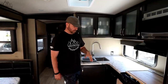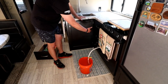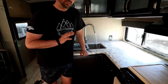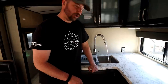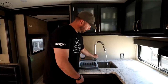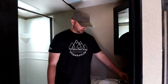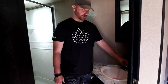Next up — everyone's favorite part of de-winterizing: getting the antifreeze out. That means camping season is here! I normally have antifreeze in this bucket when I winterize; now I've got fresh water in the bucket. I'll run it through the pump until it runs clear. This is also a great time to sanitize your system — you can add a bleach mixture, about a quarter cup per 15 gallons. I'll link Changing Lanes' great video on sanitizing your RV water system in the description. We're running clear up front; now let's go to the bathroom and do the same thing — just running the pink antifreeze out of the lines. We'll also do this again at the campsite to clear any residuals.